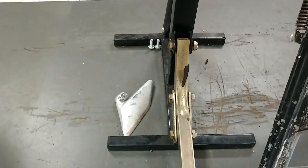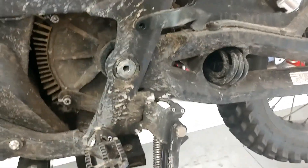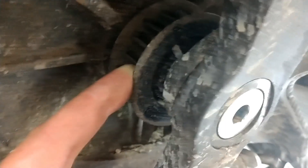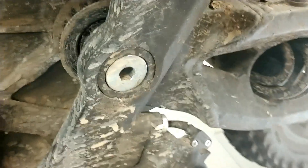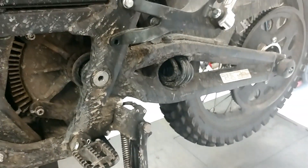I'm just getting started — I've only pulled the rear brake thing off and the boot guard here so far. I think I'm just going to pull the wheel off and these two swing arm bolts and see where that gets me. I should be able to swap the rear sprocket. To get the front sprocket off, you can't put any tension on it and obviously the motor just spins. You're supposed to heat up that bolt with a torch to sort of break down the Loctite a bit. I'm a little nervous about that because that's the main rotor shaft going into the motor. I have a torch and a big impact gun — I think it's a 6mm hex — and that's what they recommend.